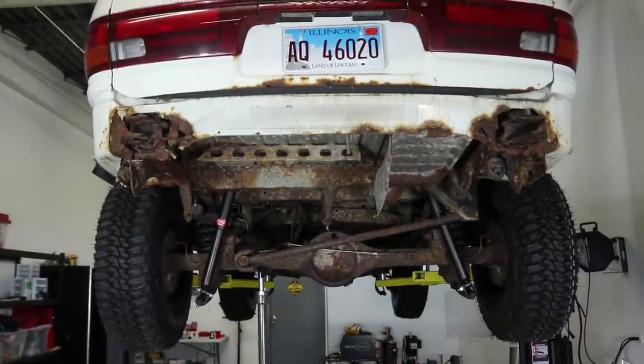How's it going, everyone? Welcome back to another video. Today is a very exciting day because by the end, we should hopefully be able to drive the battle van for the first time since we purchased it from Milwaukee — able to drive this rusty piece of beautifulness. In order to get this van driving, we have to do two separate things: replace this shock which just doesn't have a bushing, and then make some new brake lines up front, bleed the brakes, bleed the clutch since they use the same reservoir. It's not going to drive amazingly because it needs an alignment and more chopping of the front so it can actually turn, but it will drive.